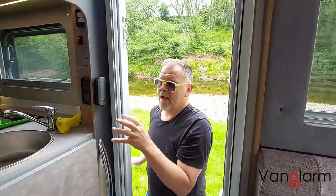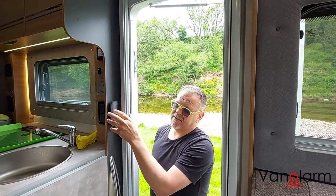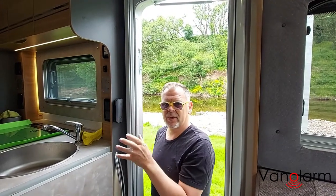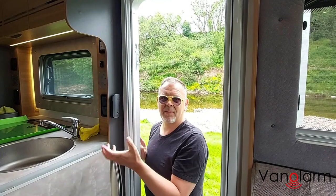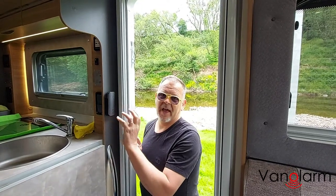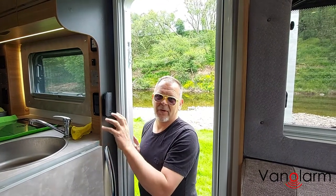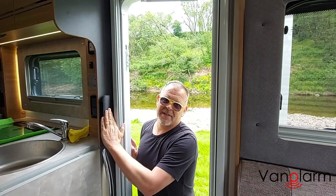The alarm has already been set up using the app on your phone and is live. When it hears the siren it is set at a really high decibel range, so it shouldn't go off through voice or ambient noise. However, in campervans it can be relatively loud while traveling, so it's probably best to turn that noise sensor off on your phone while traveling, and arm it every time you go in and out of the vehicle. Door sensors are fitted, smart alarm sensor is fitted, and we're all ready to go.